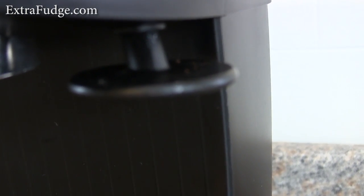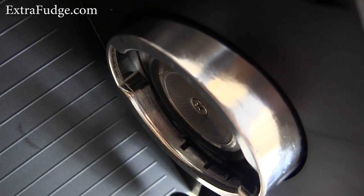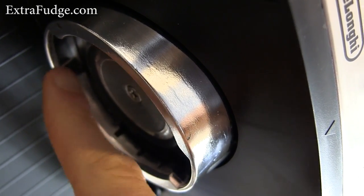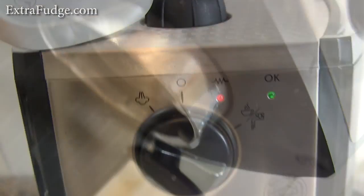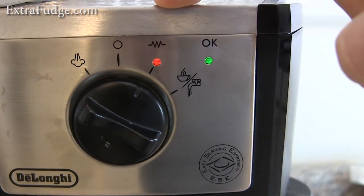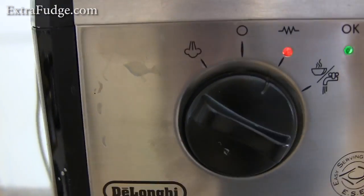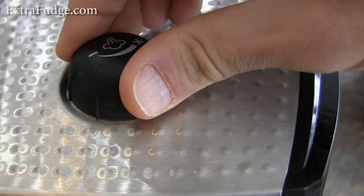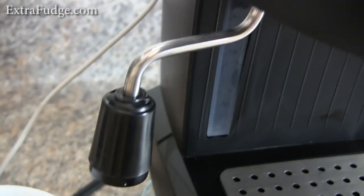It also comes with a tamper, but I found that this tamper is really bad. You really need to tamp the coffee very well to get a good shot out of this machine. If we look at the bottom of where the water comes out, you can see this element and this rubberized ring — the rubberized ring keeps the pressure in the vessel. This is the dial: zero is off, the squiggly setting warms up the coil and water, the next setting starts pumping water through the portafilter, and the last one is for steaming milk. This dial needs to always be at the minus part, which opens and closes a valve that releases pressure through the wand.